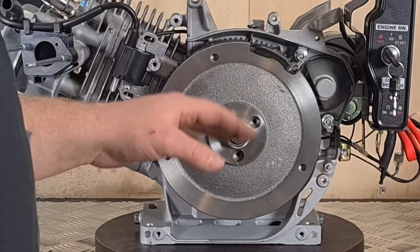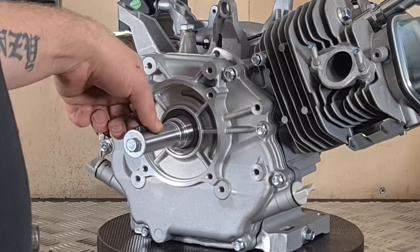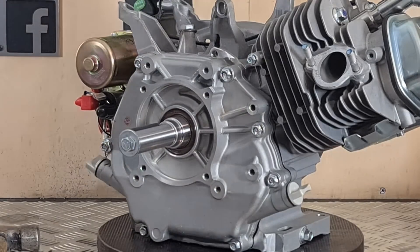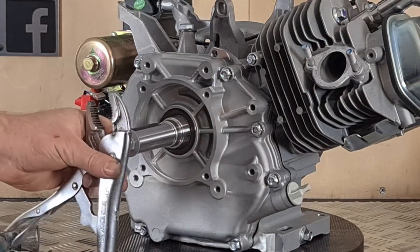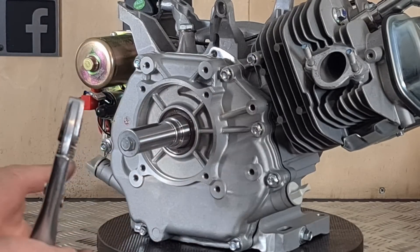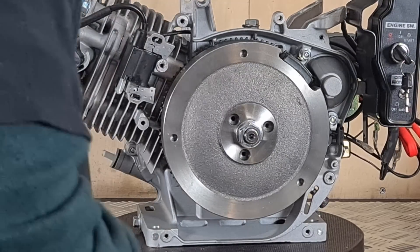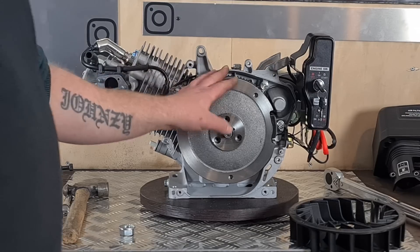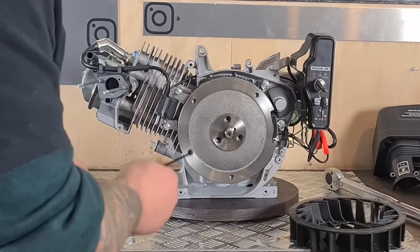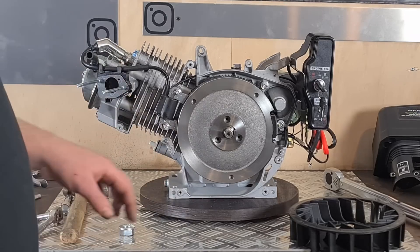The manufacturer's torque specs are very important for this. What I normally do is put the keyway in, put some locking pliers or vice grips on there, and then lock it down onto the bench. I will put this wheel back on — all I use to set the coil gap is a cable tie in between the coil and flywheel, and it sets the gap up for the spark every time.